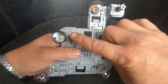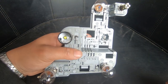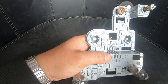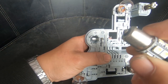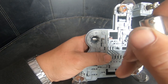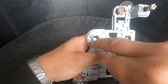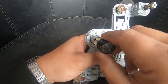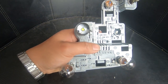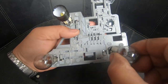I've also changed my reverse light to LED because I have a reverse camera and wanted a brighter light. It replaces exactly the same — all you have to do is push in, rotate it left and it simply comes out. Your bulb has prongs on both sides and a negative terminal. To replace it, line it up with the grooves of your light, then push in and rotate clockwise to the right. To release, push in and rotate left.